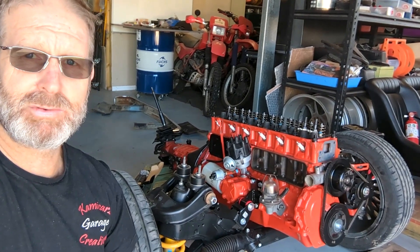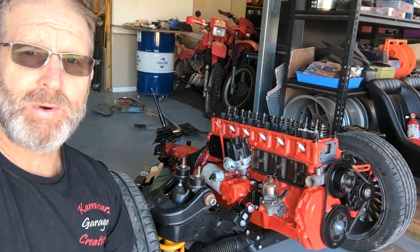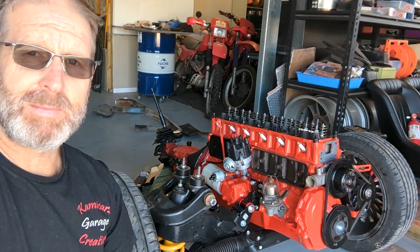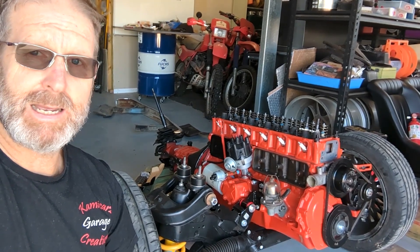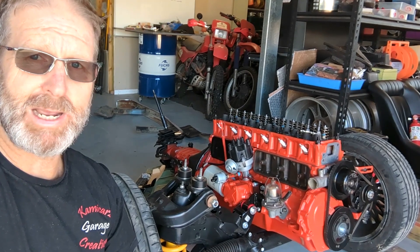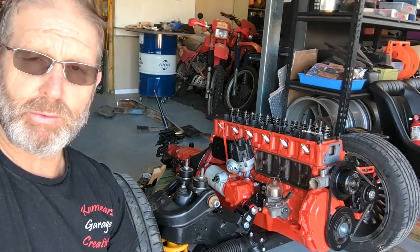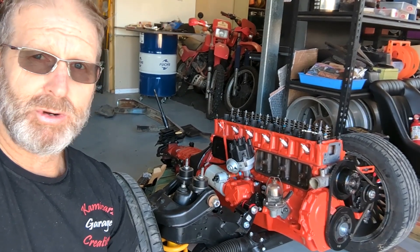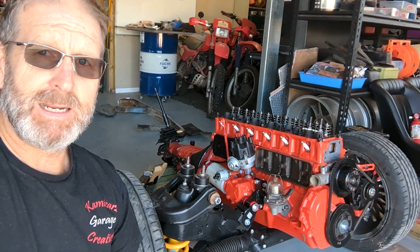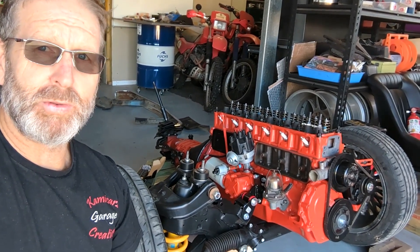It's still a good little motor and it's still cost me a bit of money, but just trying to do it right all the way through. I've taken the side covers off and I'm going to slip the new lifters in — I've had them resurfaced and got that little crown on them to perfection and polished up. I'll wax some of that graphite lubricant on them — the goop that came with the cam — and slip them down in, then get the push rods on.